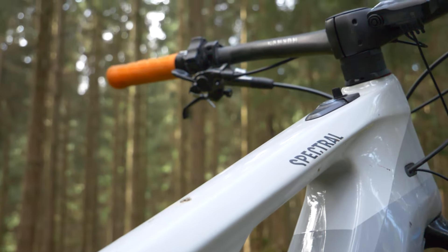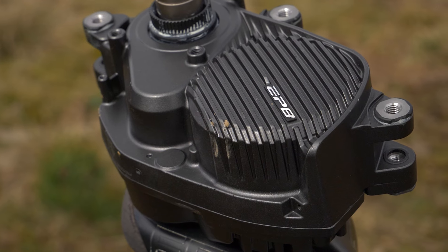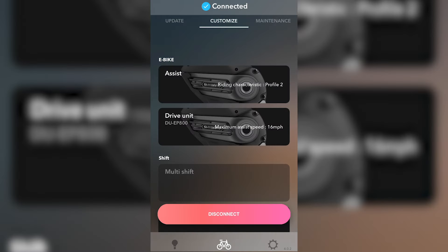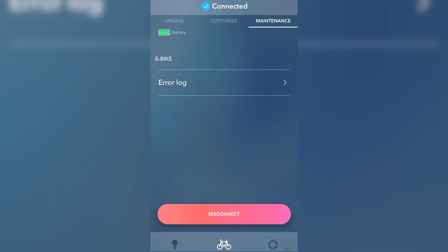I could actually do a whole section just on tires and their relationship to your EP8 motor and battery, because they have a significant effect on what you do, where you can climb, and the range that you get out of them. A quick tip — if you've got a mate who is significantly lighter and has a bike which might be a bit more powerful, you could actually speed ahead of them just by being sharp on the tire choice. You could be looking at an extra lap of the trail centre, a couple of extra climbs just by having different rubber. Flip that and you'll be able to climb steeper banks and gain more confidence descending. Your bike will also need an update from time to time — Pete from Shimano explains that the EP8 system will log potential errors which can be displayed when you connect to it via the E-Tube Project app, so you can look up a potential fix to the problem you've had.